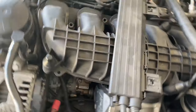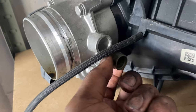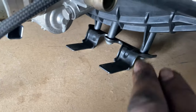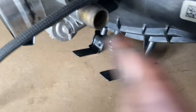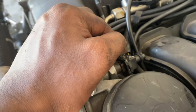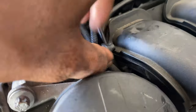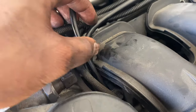In the back you'll feel a solid black box holding on, so you deal with it until you pull it back some more, then you can easily knock it out. The piece I'm talking about looks like this — pull it off the sensor, then squeeze and take the vacuum line off that nipple piece. The black thing underneath slides onto a peg and has a dimple that catches it, so just knock it this way. With the vacuum lines off, disconnect the oil pressure sensor: push down and it comes off.